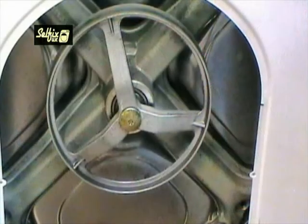The hardest part of this task is to unscrew the central pulley bolt because they have been fitted with so much Loctite that even without the thread it would be hard to remove them. You'll need a size 40 Torx bit, and if you have to buy one then opt for the high impact version because the cheaper ones could snap as you try to undo the bolt.